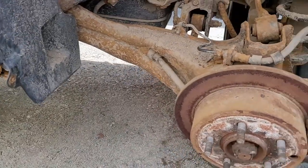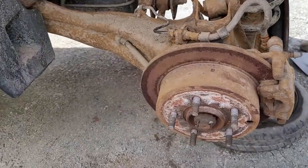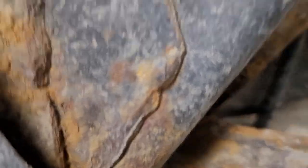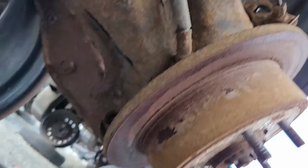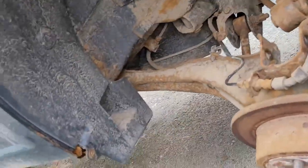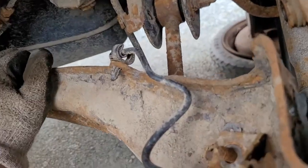So that's where I'm at. I just yanked this puppy off - it's got a good rotor here so that's coming with me too. You've got two bolts up in here, they're 15s. Those came right out - nothing. On mine I had to use a breaker bar.